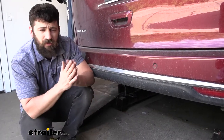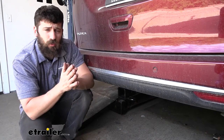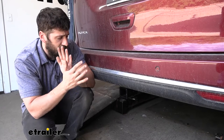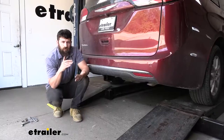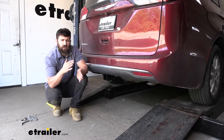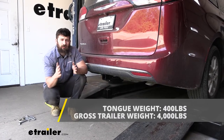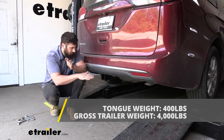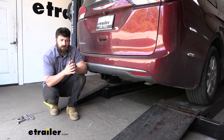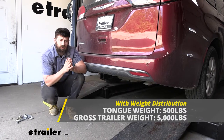It's going to make your vehicle that much more versatile. We can obviously use the trailer hitch for towing, but if we want to hit the trails or need to free up space inside the vehicle for long car rides, we can attach either a bike rack or cargo carrier. Our trailer hitch has a Class 3 rating providing a 4,000-pound gross trailer weight rating and a 400-pound tongue weight rating. We can also use this with a weight distribution system, and our capacities increase to 5,000 pounds and 500 pounds respectively.